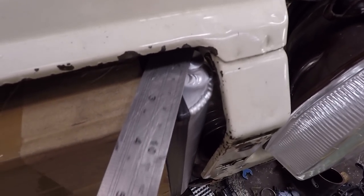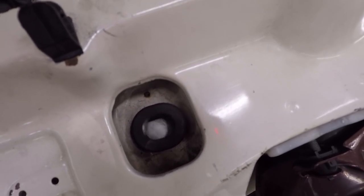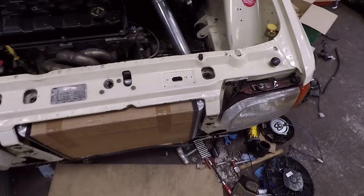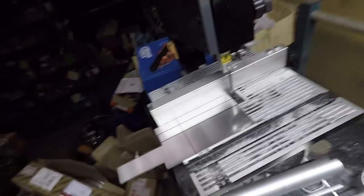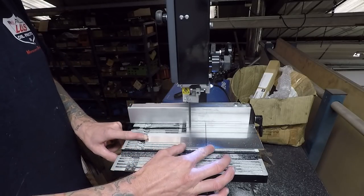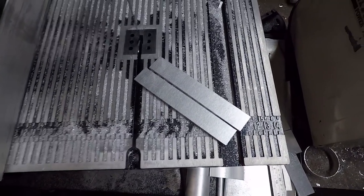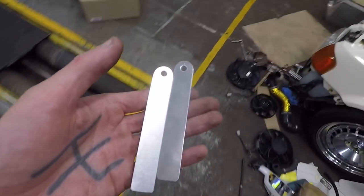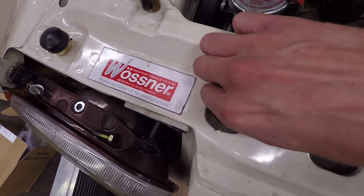For these top mounts I've basically welded on two strips, about 120mm long. They come in, I weld a pin on that, then we slip them in and out and bolt them on so everything can come out easily. I used my trusty eBay bandsaw to cut some little strips - I'm going to turn these into top mounts with rounded ends, bolt holes, and pins. The pin comes through the original mounting holes which I actually really like the idea of.